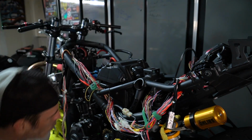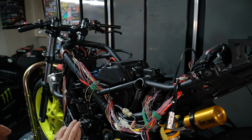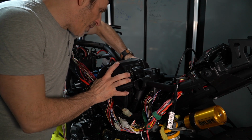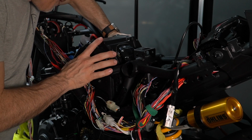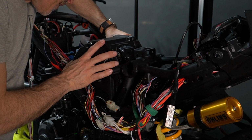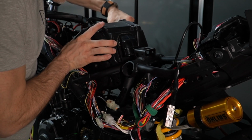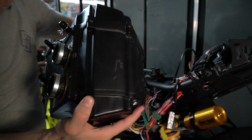Once you remove the two hoses on the right side, on the left side there's also another hose that goes from the air box to the crankcase. On the right hand side, this is a bit hard to see. Let's see if I can do this with a screwdriver. This is the hose that's typically connected to the air box right here. I've simply removed the retaining clamp and pulled that hose so that the air box is now free to move. You also have to disconnect this before removing the air box. Now, once this is done, you can simply push the airbox towards the back so that the funnels or your stacks disconnect from the throttle body, and then you can lift up gently and wiggle it up, and you have the airbox that is now free.